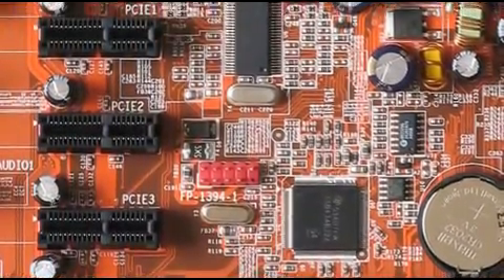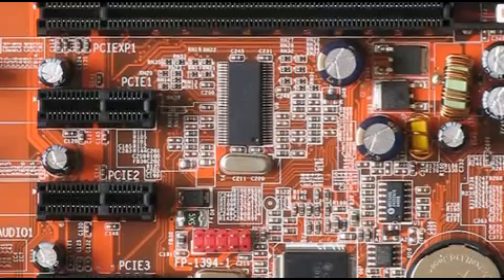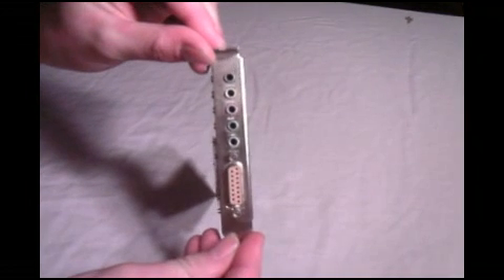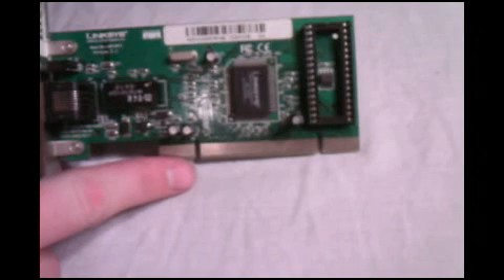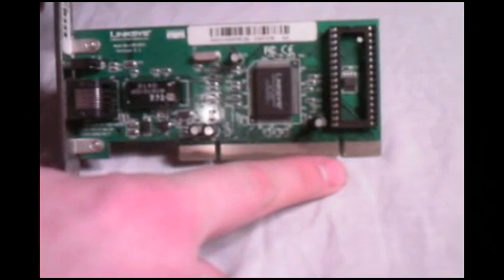Open up an expansion slot in the back by unscrewing and removing a single metal guard. Then lay the card into the slot, pressing evenly on both sides. You will feel the card snap into place. If you find yourself putting too much pressure on the card, make sure that the card and notches are aligned to the slot. After installing the new card, the software that came with the upgrade should then be installed — this software contains the driver for your device. Many things like RAM and processors need no drivers after installation, while most other devices come with software and documentation. It is important to keep the documentation and especially the software that comes with your newly acquired device.